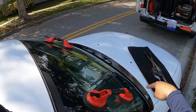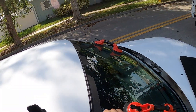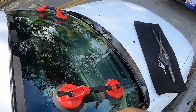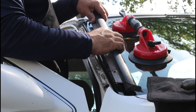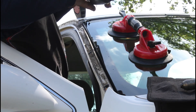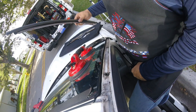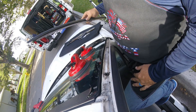As you can see, I've already got the windshield installed — it's symmetrically placed. This is technically a glue-down molding; they call it a push-in molding. I did install it to the glass before it goes in because the fast-cure urethanes that we use nowadays actually cure a little too fast for the push-in molding, so it's better to apply it to the top of the glass first before it goes in.